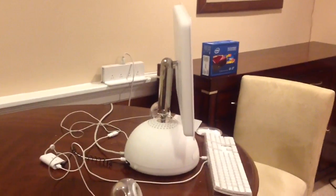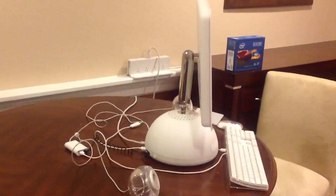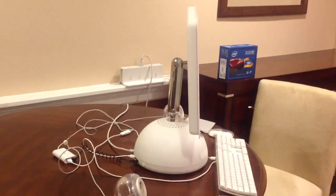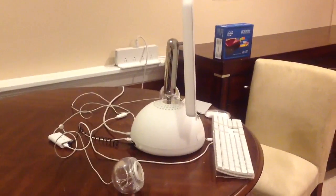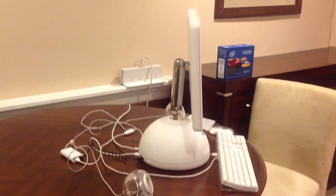You can just appreciate just how thin this is for a CCFL display. It's pretty remarkable, and Apple was able to do that because really there were no components in here. There was a very thin custom-built inverter, and there's really no LCD controller or power source, which are usually found in monitors and give them kind of a shelf on the back.